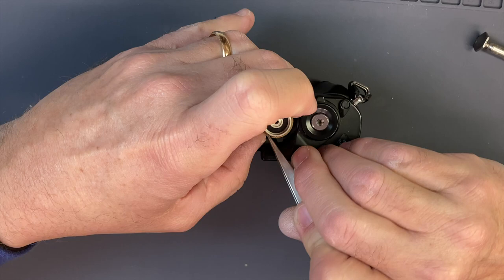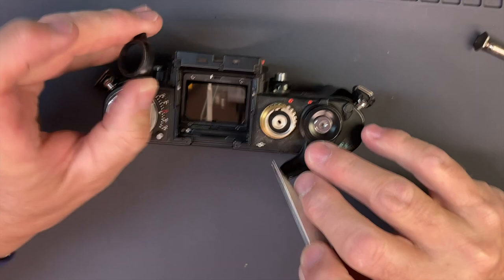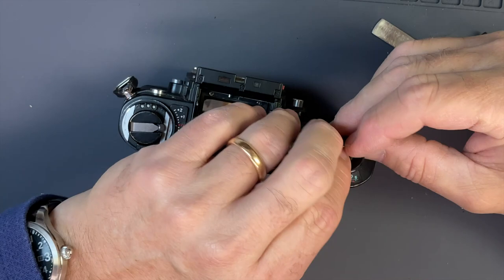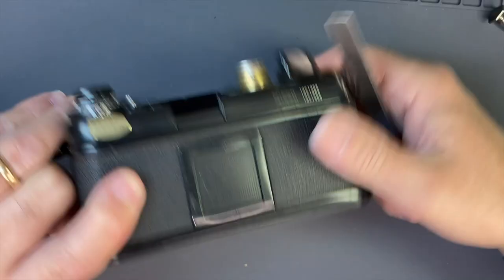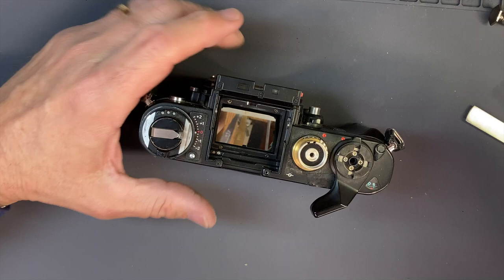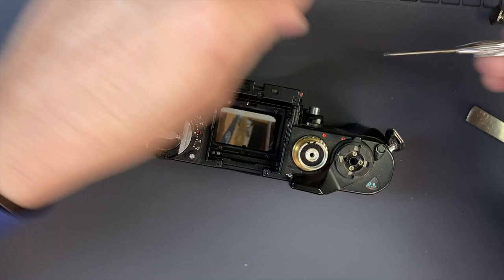Winding lever — fairly tight, most of them, but not too bad. Ring comes off. Button and spring comes off. This sometimes comes with it — this is the plunger — and there is a brass collar. Yeah, it's oxidized pretty bad. I think that's what I'm going to find: a lot of oxidation on all the contacts, and so yeah, it's not working. Screw comes off. Take the wind lever off — four screws, short little screws, countersunk head screws.